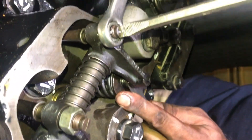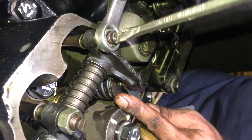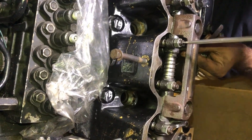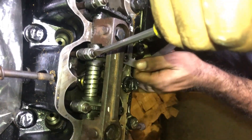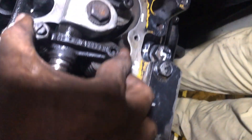Repeat this process for the remaining valves. Valve clearance is necessary for the life and better performance of the engine. Too little valve clearance throws valves out of time — valves open too early and close too late. This causes the valves to overheat due to hot combustion gases rushing past valves when out of time.